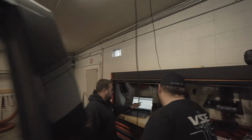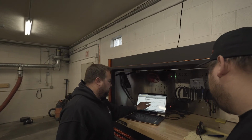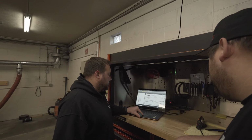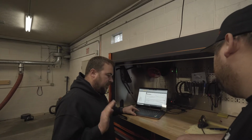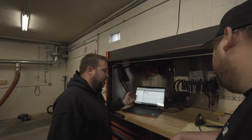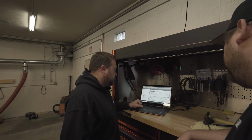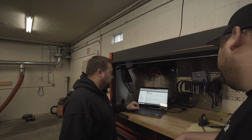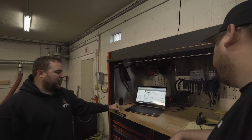This is like 120 some degree air temp hammering it. Or sorry, not. This is just the 419 is me loading it on the dyno with a brake until it sweeps all the hot air past that sensor, the inlet air manifold charge temp sensor, and then if I don't use the brake and sweep that out a couple times, it doesn't make anything. It probably would perform pretty well on the street.